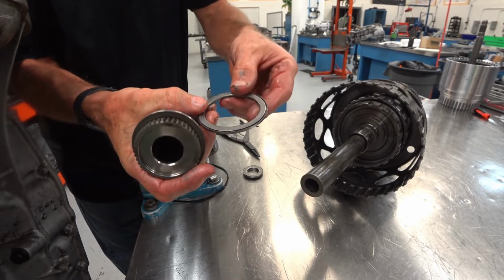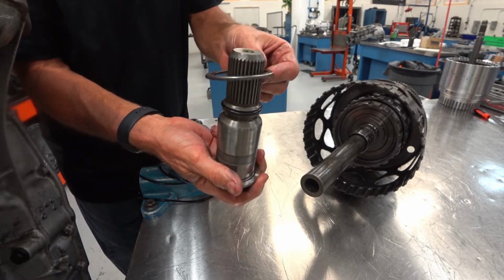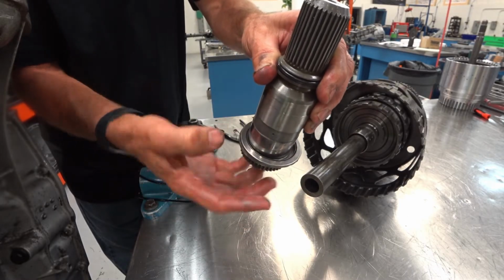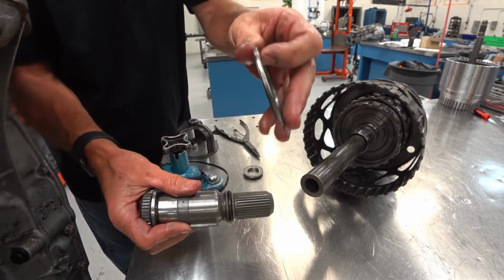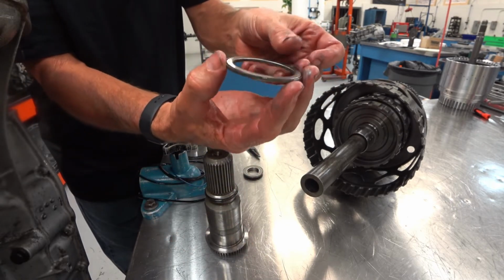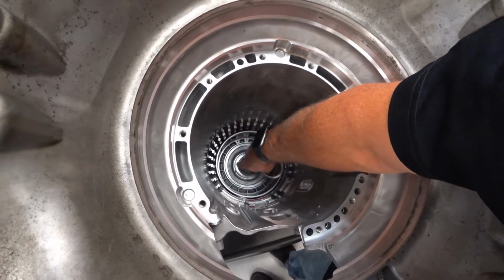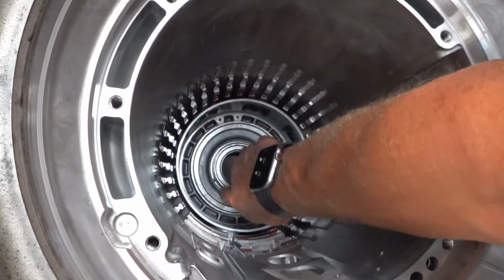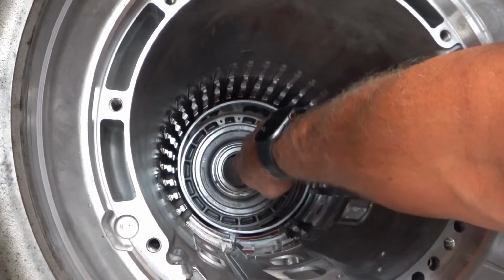So these are designed to fit either snugly with a shaft, like if this fits snugly around the shaft, you lay the parts down in the shaft and it would rest on that part and kind of wrap up around the inside. But on this one, it's very loose around that. So it's probably designed to fit into a machine pocket. And if there's a machine pocket on a part, the pocket is designed to kind of center and hold the outer race. It might be hard to tell, but this is a machine pocket down here at the bottom of the case. So that outer race is going to fit nice and centered around that machined little groove or pocket for that bearing.